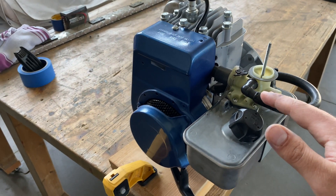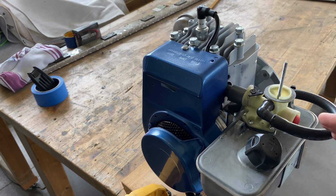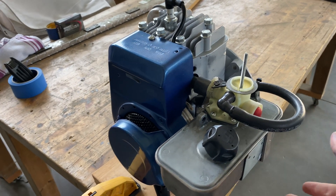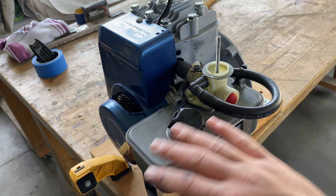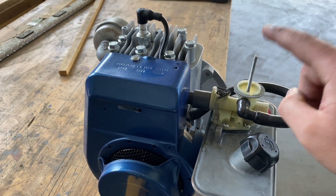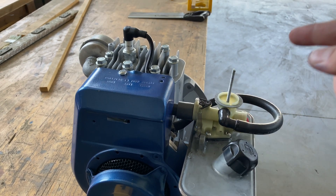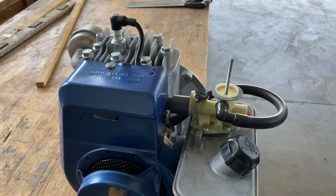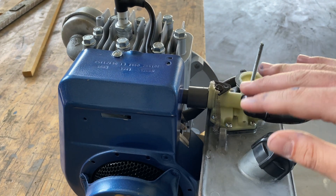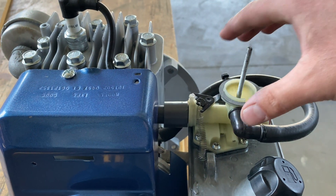In order to have it stand up and run, if I had just flipped the engine on its side with the fuel tank going vertically all the fuel would have spilled out. So what I did was turn the fuel tank, had the paint stripped off to make it more durable, and also got a new carburetor because the previous one's injection nozzle was clogged with some sort of goo I couldn't get cleaned. When I flipped the fuel tank there wasn't enough clearance, so I added this tube here to extend it a little further.